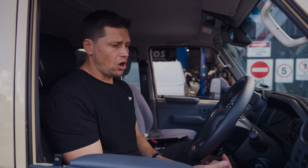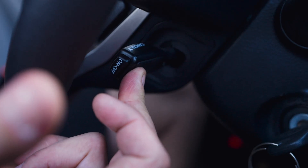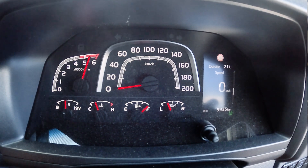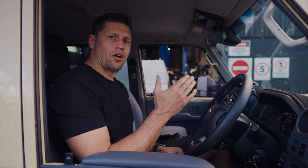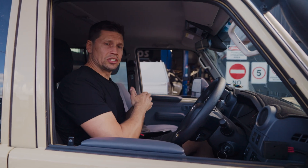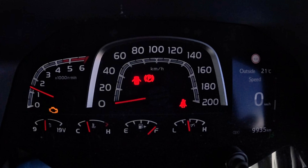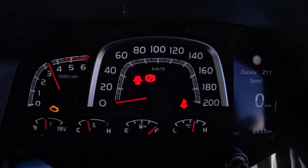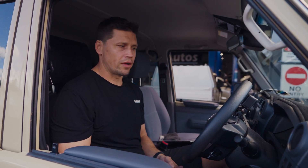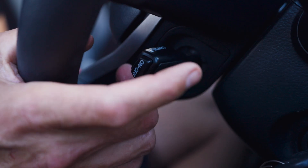You can also do this at any time — you don't have to be stopped. You can be driving down the road, hold in the cancel button, the engine light will flash, and it shows you that you're at 5,500 at the moment. 5,500 is our maximum pedal curve to give you maximum response, but you can set that interval at 4,500, 3,500, 2,500, 1,500, and 500. So you've got six different tables to select the sensitivity from. We have two full drive tables with very low sensitivity, a standard one, and two more raspy ones — one that's quite aggressive and one that's quite nice to drive. You have the variation of being able to select through those tables and set your pedal sensitivity.